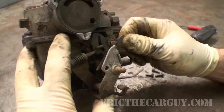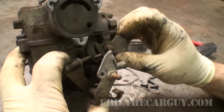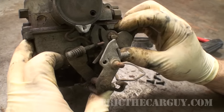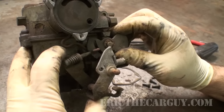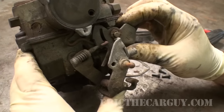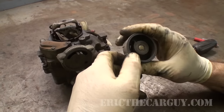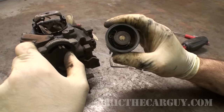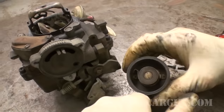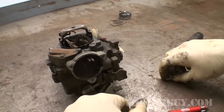When you first start it up, it's connected to the choke — the more closed the plate is, the further down this will go, giving you different levels of idle. You need to set the fast idle screw when the engine is cold. I believe mine is just a little bit too high. I also believe this choke is warmed by exhaust gas — they run exhaust gas up into here to warm this up and get your engine to a more efficient place faster. Here's our nice little gasket.